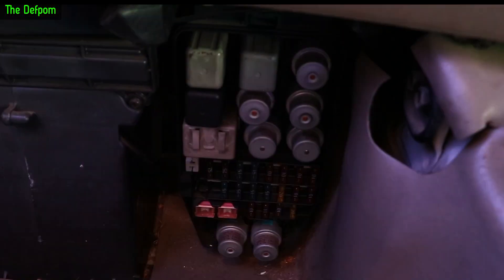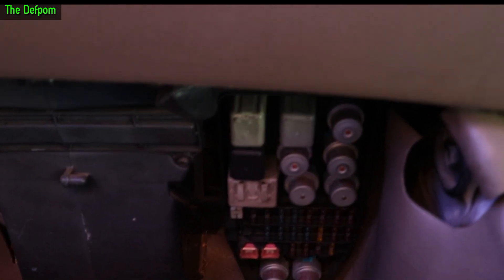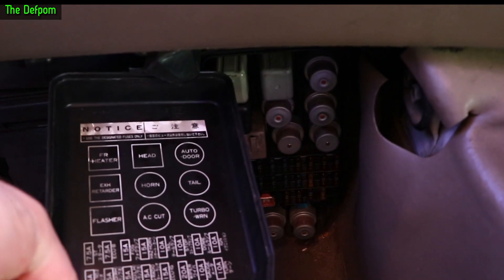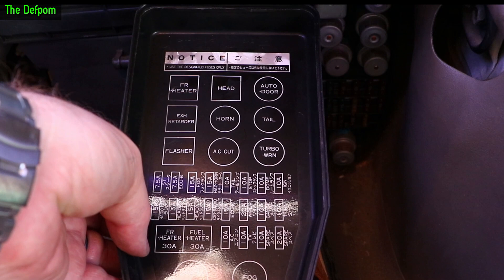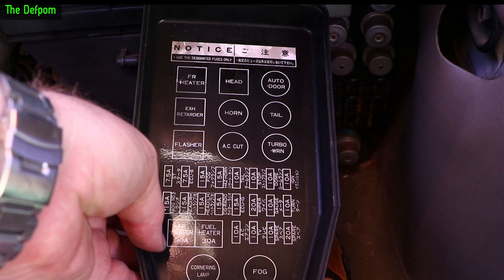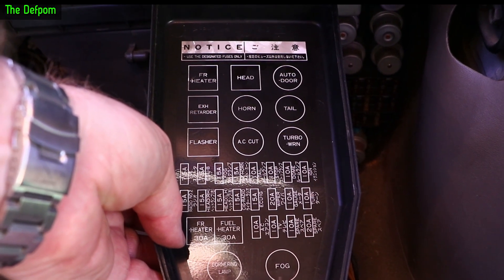So I've got to change the switch out. It's just down here on the passenger side footwell. There's actually a fuse box just there, and there's a cover which normally goes over that. Pull this off — there's a legend in there for what the fuses are. The third one over on the top row is the stop lamp fuse. I've got to pull that fuse out to disable power to that switch, so if I touch the wire against something and short it out, it doesn't matter — because that would be bad.